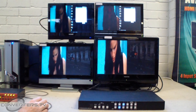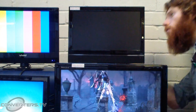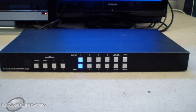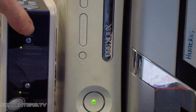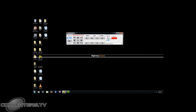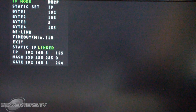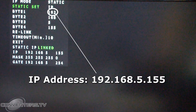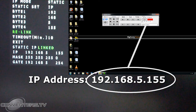Troubleshooting is also simplistic. Common errors to check for if the image isn't displaying: check that all power and multimedia cables are plugged in correctly — power is indicated by a light on the unit — check that your screen source is set to HDMI, and ensure all input sources are set to output through the correct format. If connecting via Ethernet, you may need to check the unit's Ethernet settings in its menu. If you are connecting through a router, leave the connection set to DHCP. If you are connecting directly through a PC, you will need to change the connection to static. Note down the IP address of the unit, then on the software interface, change the Ethernet IP address to that of the unit and hit connect.